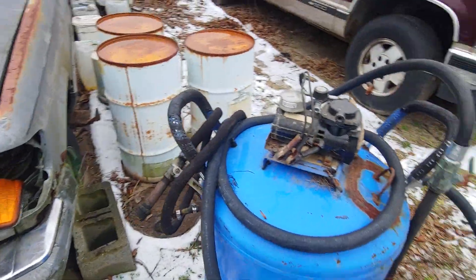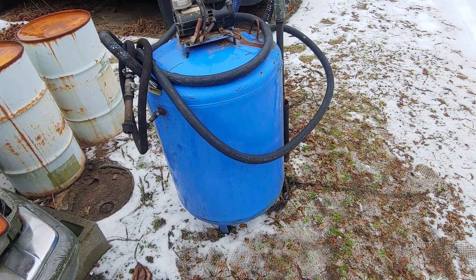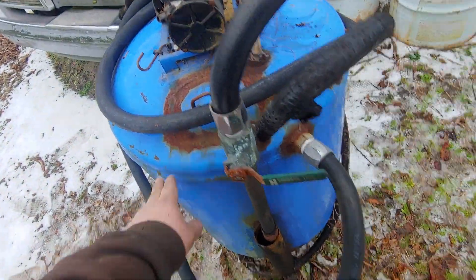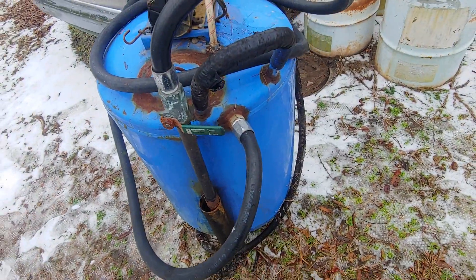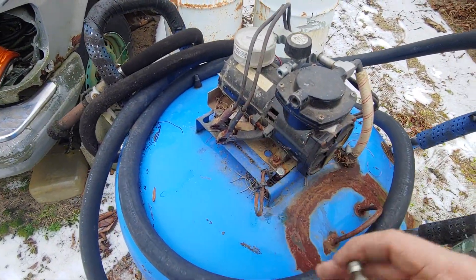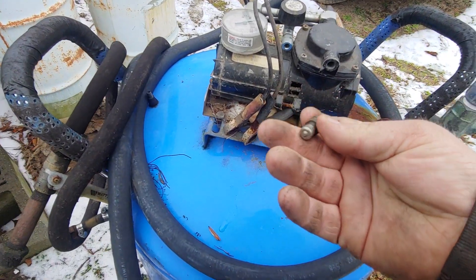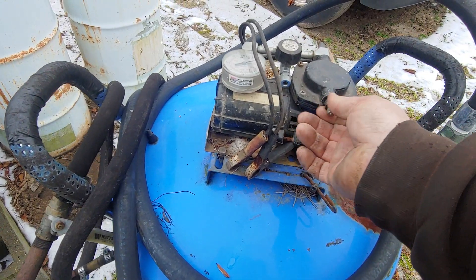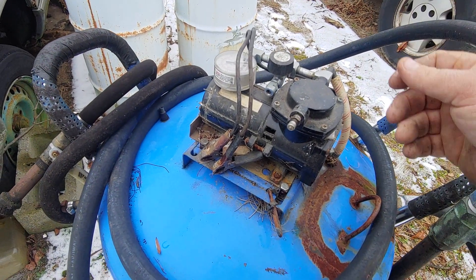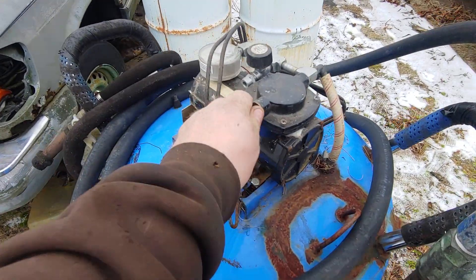This thing can sit in your car or in the back of your truck. It's basically designed like a septic truck — you pull a vacuum on the vessel and then suck the stuff up. And as long as you stay away from the chunks, if you got this line clogged, the good thing about this is you can pressurize this tank and then open this valve and just blow air through here to blow whatever debris got in there. If you take one of these pumps and replumb it with some valves, you could probably use it to pull a vacuum and to pressurize this tank, all standalone on the tool battery. But when you do pressurize, I had a Schrader valve that I would put in here to keep mud daubers out. You have to block this off to pressurize it because this is a check valve in here that only goes one way, and it will bleed out of here when you put your pressure in and you'll lose pressure. So I would just spin that in by hand — it was enough to hold it back.